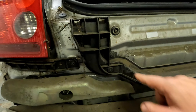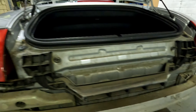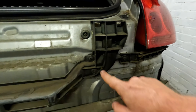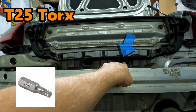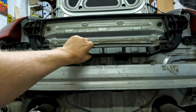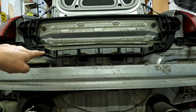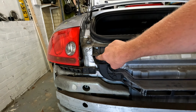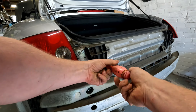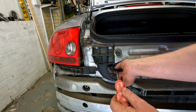Let's take a closer look. Here is the plastic part that the top of the bumper attaches to. We can see it is attached with T25 torx screws just there. Moving across, it's the same on the other side. The plastic fixing for the top of the bumper also has two lower T25 torx screws holding this part in place, so there's a total of six holding this on. Let's get that removed first.